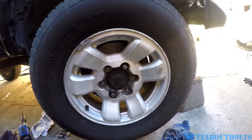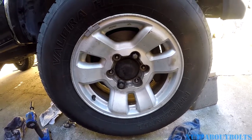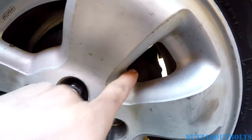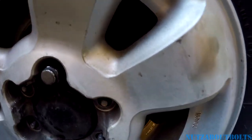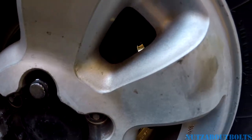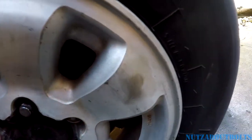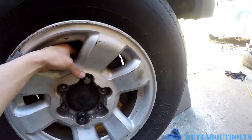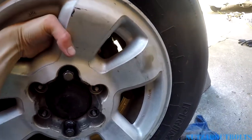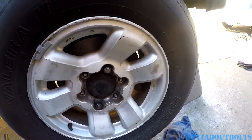These are the original wheels that came on the 97 4Runner — the same wheels that came on Tacomas 2000 and below. Here is our caliper — if you go to put the wheel on, there is definitely rubbing. So that's one thing you're going to have to address. I've seen people online say that you can just grind the inside edge down. I don't know exactly where it's hitting, but these wheels would have to be ground down or you would have to put a spacer — quarter-inch, five millimeters, something like that.